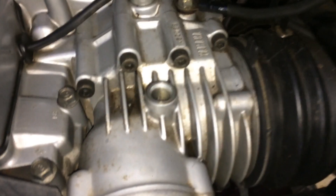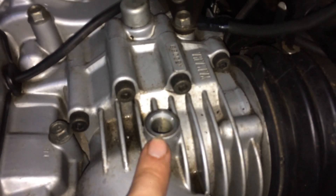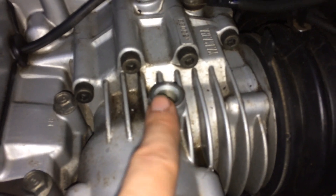I thought I'd show you this too — I had to heat this up with the heat gun again, just over body temperature, kind of like warm bath temperature. I was able to break that free pretty easily. And if you haven't seen where the drain plug is for your mid-drive, it is right there.